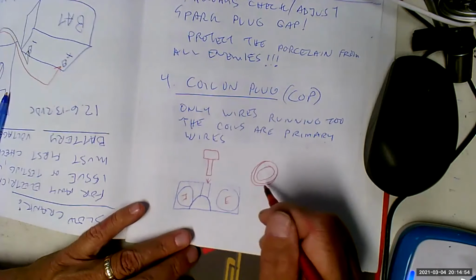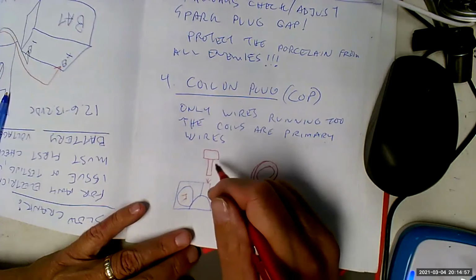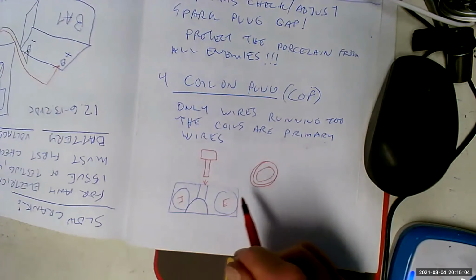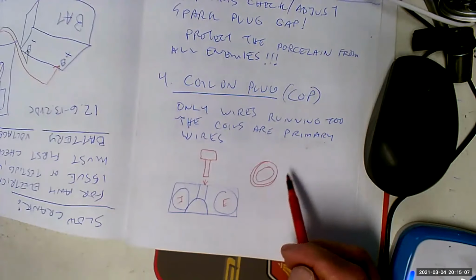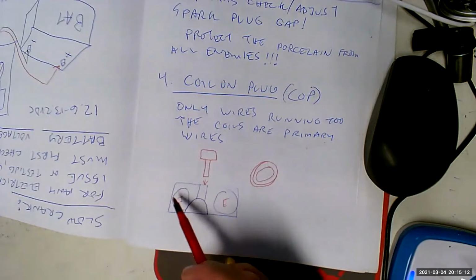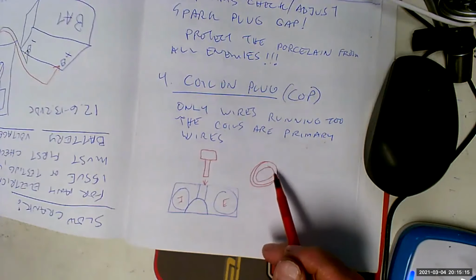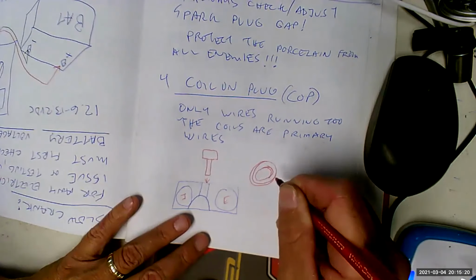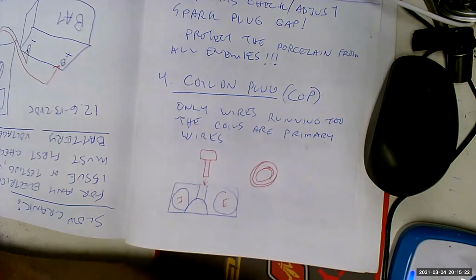If these start leaking, the oil gets inside where the coil is and often causes a misfire. If you're going to replace the plugs, or if you pull this out and it's wet, you need to replace this seal, and you might as well replace the outside gasket while you're there, because that has to be dry. Or it starts conducting where we don't want it to, exactly what happens when we install stuff with dirty hands, and that can beat stuff up pretty hard. So don't do that. That make sense? Yep.